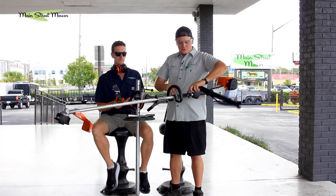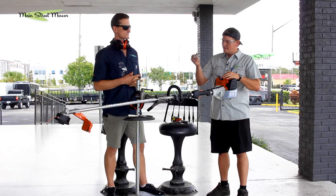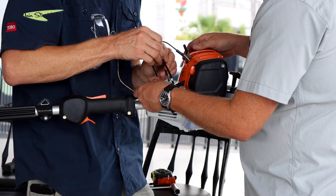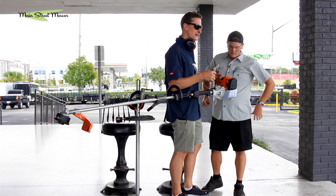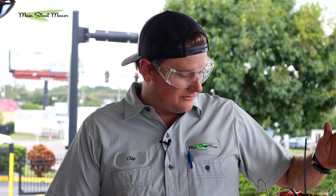So we're going to do a baseline test. This is a brand new one out of the box, never been run — we're just going to let it run until it gets up to temp and we're going to check the RPMs. This is an OEM Stihl tachometer; it works by reading electrical pulses, so you attach it to your spark plug lead. This is an air-cooled engine, so the fan and cover are important — they direct airflow around the cooling fins. Having the cover off may affect air travel a bit, but since we're leaving it off for all line-length tests it'll still be a fair comparison.